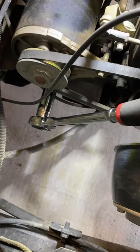From this side you can see the bolt all the way at the bottom — there's the nut right there. I'm gonna put a wrench on that and loosen both sides. A little trick: position a ratchet wrench on that nut so that as you loosen the other side, the nut's gonna want to go down and force the wrench against the skid plate — you won't need two people. I've got the wrench on the nut on the other side and the 3/4 socket on my ratchet here, and I can loosen this side much easier.